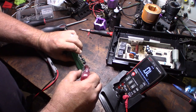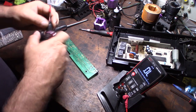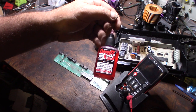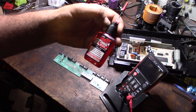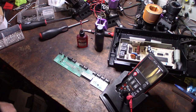I'll put this back together and see if it works. Just put a little bit more in and let it soak. I might put a piece of electrical tape on top of it. If you're wondering what I use, it's DeoxIT DL100 — I'll put a link down below. This stuff is incredible, it's pretty expensive, but great for cleaning contacts. I use it on my cameras and for restoring electronics.